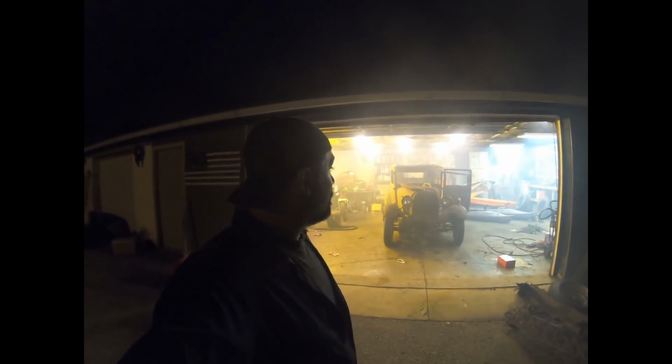It completely gassed the garage out in about 5 seconds of runtime, due to the oil in the cylinders, the transmission fluid, and the penetrating grease. But that thing took right off as soon as I turned the choke on. Very cool. I can't wait to get this thing out here and fire it up a little longer. I think that's probably going to be it for tonight, because I am not going to sit inside that thing and crank it up again and try to breathe in that garage. So tomorrow when the sun comes up, we're going to pull that out in the driveway.